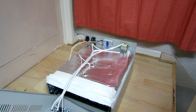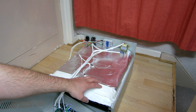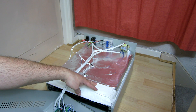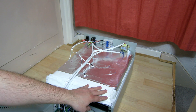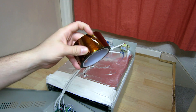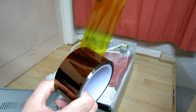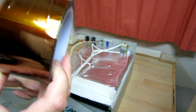The reason we've had to open this up should hopefully be obvious now. There is masking tape here on top of the heat shielding. The first time you heat this up, all the glue on this masking tape is going to melt and it is going to smell absolutely terrible. Apparently you can't get rid of the smell in your house for weeks. So the absolute first thing you've got to do if you buy one of these is take it apart and take the masking tape off. We're going to replace it with polyimide tape - this is high temperature tape so it won't melt as easily. This is the sort of brown-yellow tape you see, often known as Kapton tape. You should be able to find this at electronic suppliers, eBay, places like that.